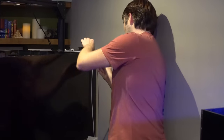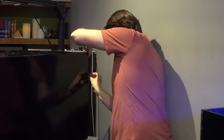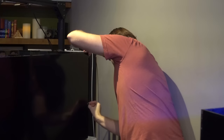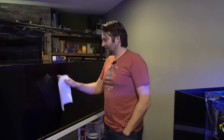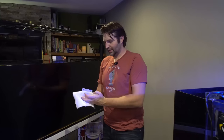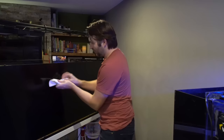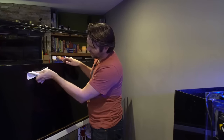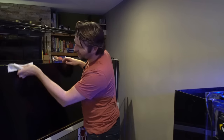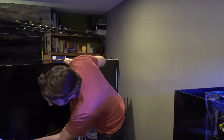If there's any little edge where the vinyl is too big, just run a razor blade right along the edge of the glass and cut off that little extra strip. One other tip: if there are any little water bubbles or spots, you can take a credit card and fold a piece of paper towel over it and just push those little bits of water to the edges. The paper towel is key — it won't scratch, and if there's any moisture it'll soak it up so it doesn't get sucked back into the vinyl.